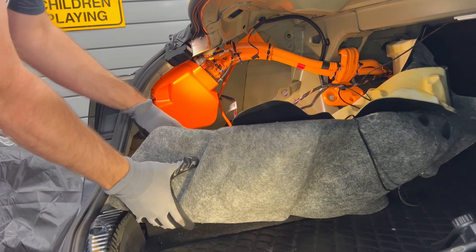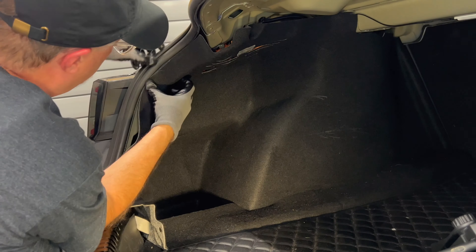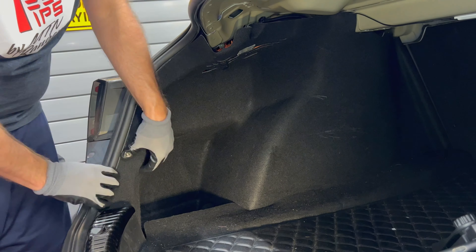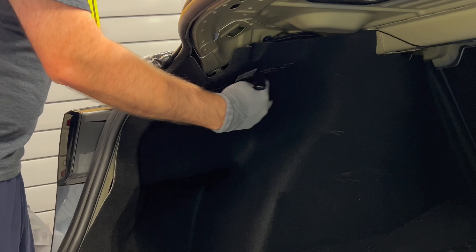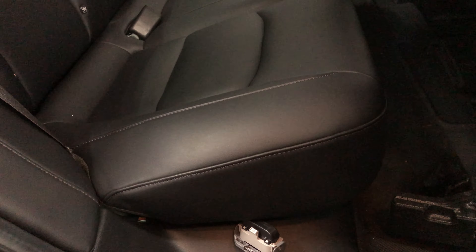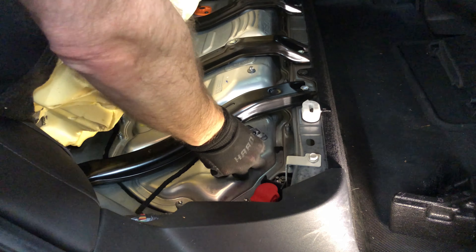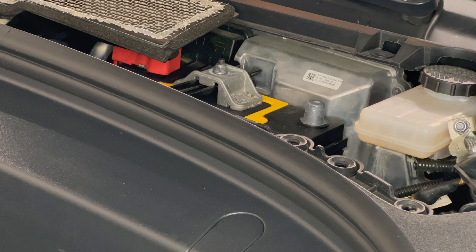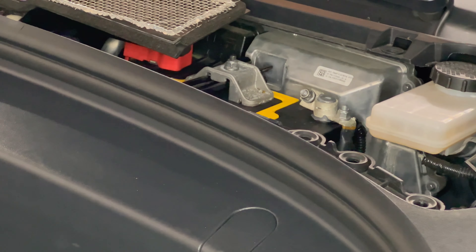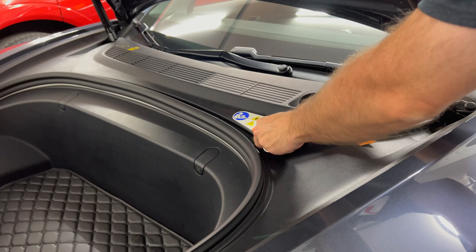Carefully fold back the fabric trim so that it fills the pocket well and lines up with the edge of the trunk weather seal. Adjust as needed to get everything back into the original position — be careful not to pinch or move any of the wiring. Don't forget to reinsert the trim clips into the trunk frame. Now we reverse the process of attaching the electrical connections: put the high voltage connector back in place and don't forget the foam piece. Back under the hood, connect the 12V battery negative terminal and tighten the bolt, then place the service panel back on.